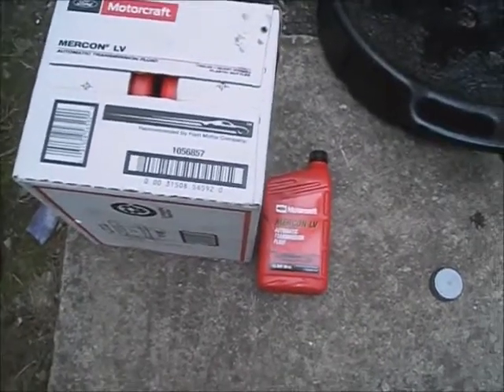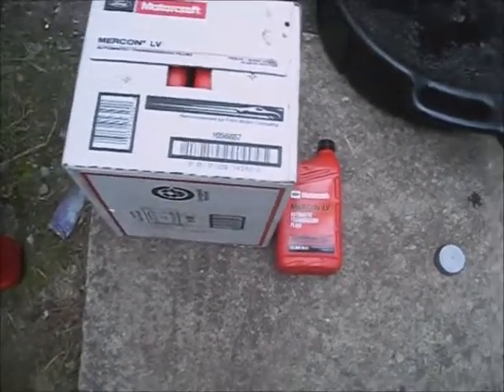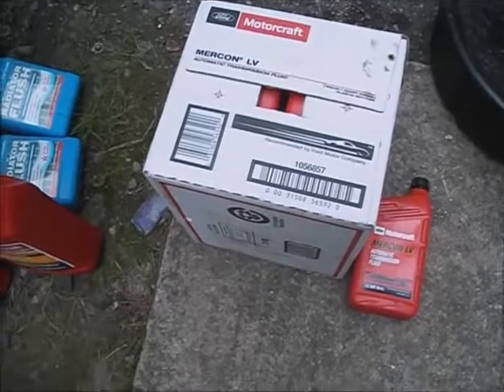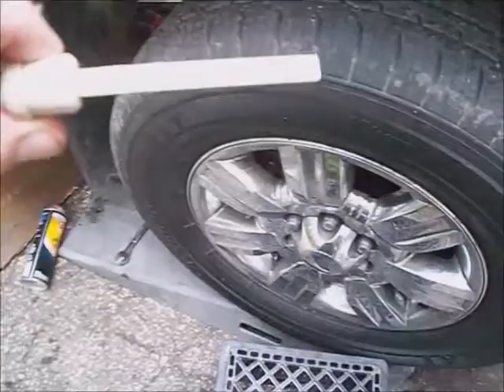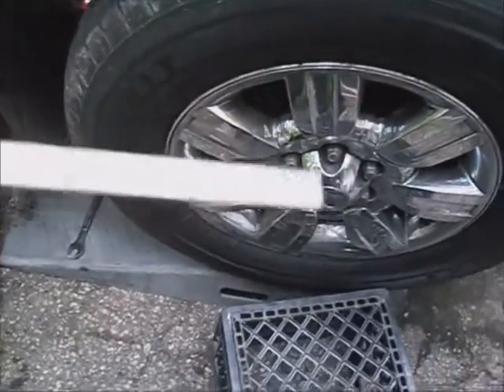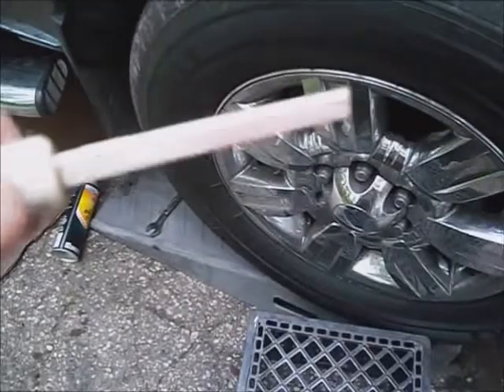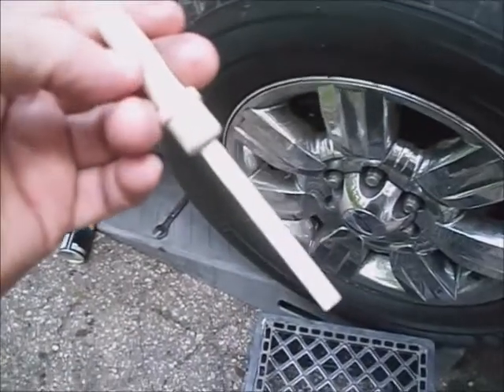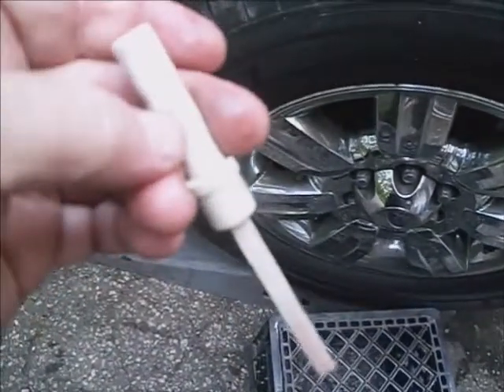I've got 13 quarts of LV Mercon fluid. The plan is about 5 or 6 quarts for the first run — fill it and drive it a while, then drain it back out and top off with another 6 quarts and possibly some change. With 4 quarts in, there looks to be plenty of room for a fifth. You stick the dipstick down in the hole and wiggle it until about 3 quarters of an inch is left — that bump probably stops it from going all the way in.